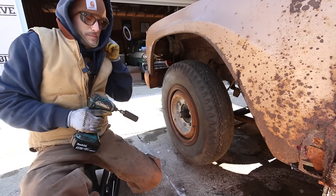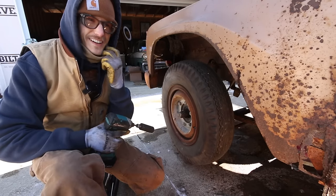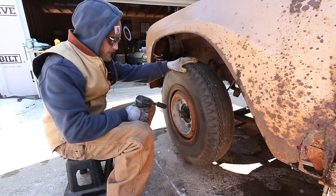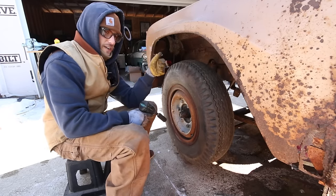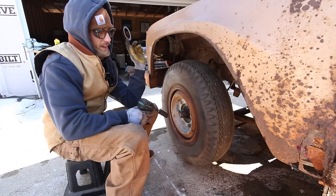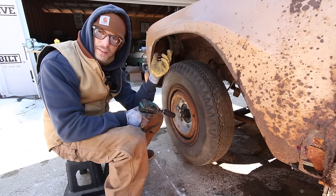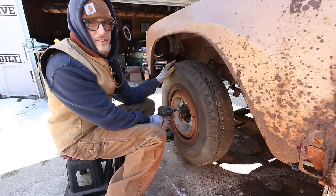She's running like a sewing machine. All right, let's get started on brakes with the front wheel first. This is going to be the easier of the four. Now on these old Internationals, the lug nuts on the driver's side are actually reverse thread, and on the passenger's side they're standard — so you're actually going to go to the right, righty-loosey for these.